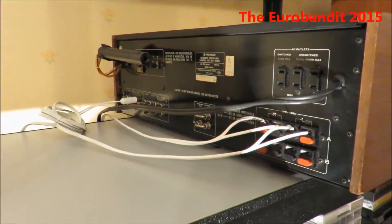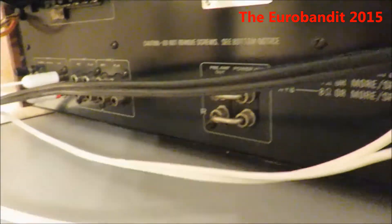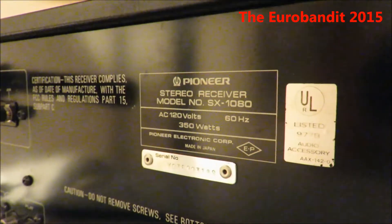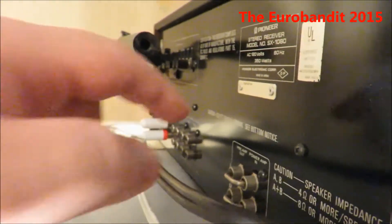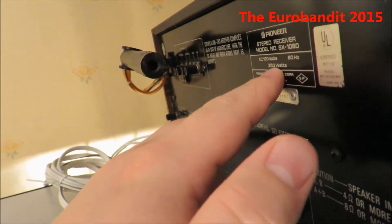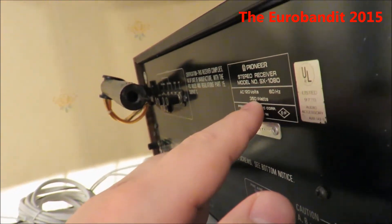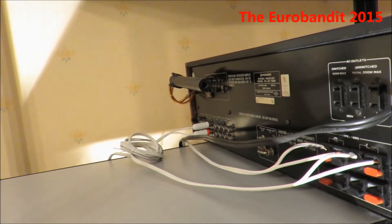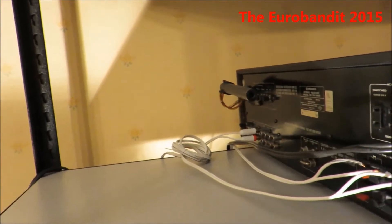And this is how the backside looks like. It has some AC outlets — American standard, 120 volts, 60 hertz. Here's the speaker input. This thing can also be either a preamp or a power amp. And of course it's made in Japan. The converter I have can do maximum 500 watts, but this receiver is around 350 watts — here in Europe we calculate the maximum power it uses, so it should be at least 1000 watts. If I would keep this receiver, I would definitely invest in a better voltage converter — at least 2000 or even 3000 watts. They're pretty cheap on eBay.